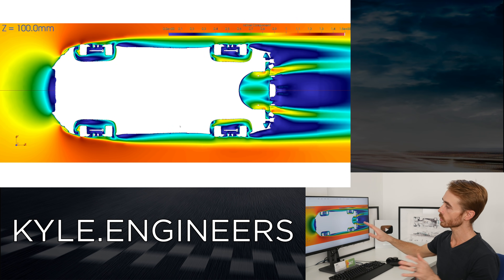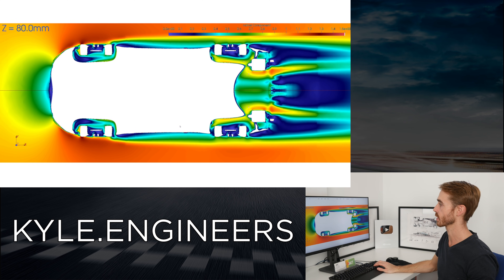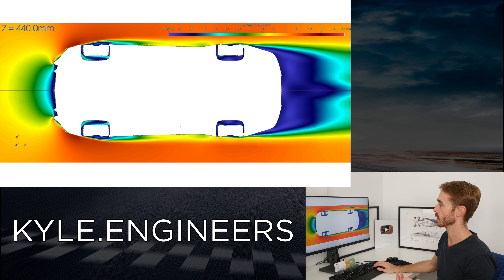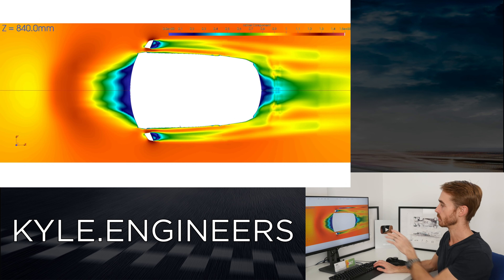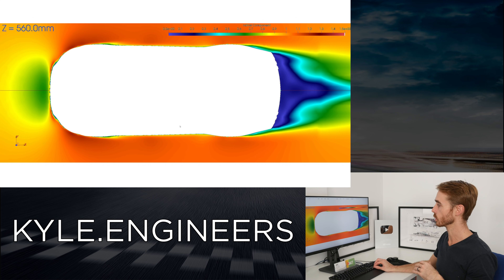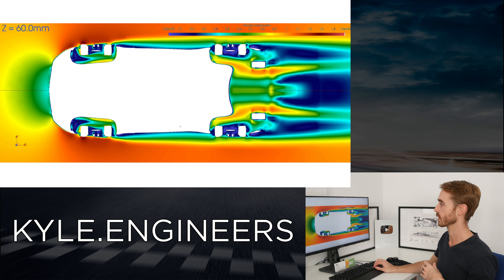What we're looking at here is a top-down view of the car. Sweeping through, that's underneath the car down there; coming up through the mid portion of the car, here is where the hood starts falling away, and up here is the roof region. That's the mirror wake just there. So this should give you a rough idea — we're looking at flow velocities around the car, which shows us what our wake profiles are like.